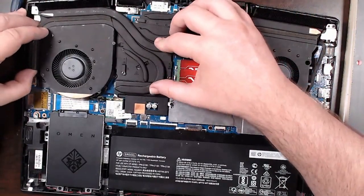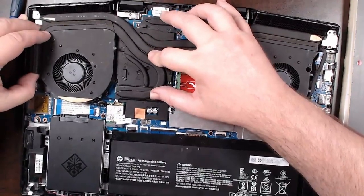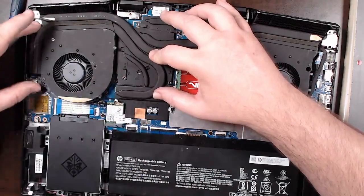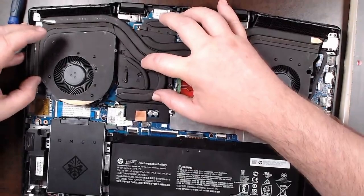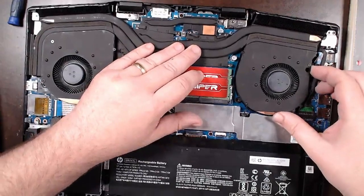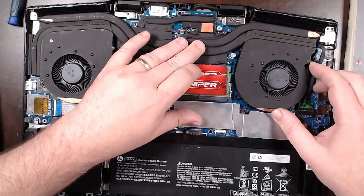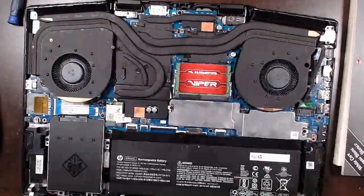I'll bet you anything that's what the problem was. The liquid metal wasn't really touching anything directly but it always seemed to occur when it was idle. Like anything in a system, it's going to have some flexion with heat — my guess would be as it cooled down things would contract and that's when it would make intermittent contact.